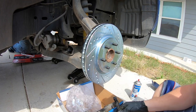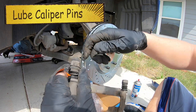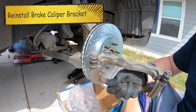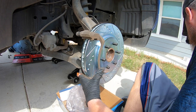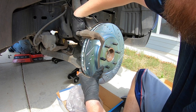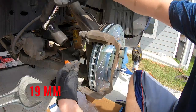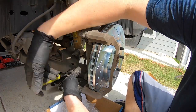Go ahead and grab your bracket back. You want to make sure you have a good amount of grease — this one actually has a lot of grease in it, so we're good. If you don't have any grease in there, you are going to want to add grease. Make sure to put it back how it's supposed to be. Then put your bracket back on. Depending where you live and how much rust you have, you may need to spend more time scraping rather than just spraying, but this is in really good shape. Now put these bolts back in with a 19 millimeter, going until it stops. Most of the time I do it finger tight, but I'm just going to use the ratchet on this.